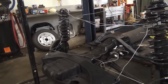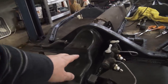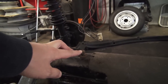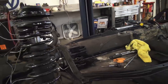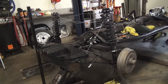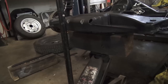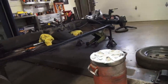So you're not going to be able to really roll this chassis as you are working on it. What we did here is we got some wire just to kind of keep this upright and in a workable condition so it's not so lopsided. That's one thing you'd have to consider. Also, the Super Beetles mount in a couple of areas to the shell, so you've got a couple of mountings here and inside the car a couple more. There's a brace on the inside of the car — a few areas you've got to disconnect when you want to take the shell off the chassis. If you want to roll the chassis around on your garage floor, you can do like what we did — we've got a jack underneath it and we can just move the jack and the chassis will move.